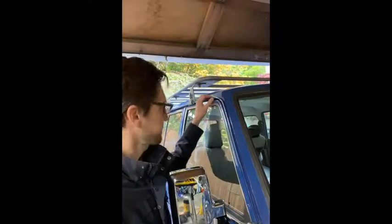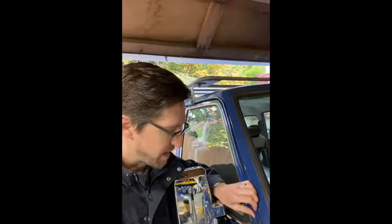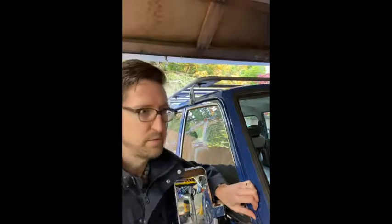So we have the 60 series here for demonstration, but this methodology can be applied to the 40 series, where you're putting down new seam sealer, or the 70 or even 80 series. If you have gutter trim, take it off, and then the messy job begins. You have to actually get out all this old seam sealer. It's pretty nasty. I used a Dremel with a synthetic abrasive brush. Others have used an angle grinder with a really thin wire wheel to gouge out that old seam sealer quickly. That's definitely a much faster way. The Dremel way was definitely slower.